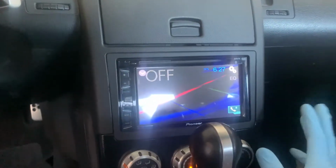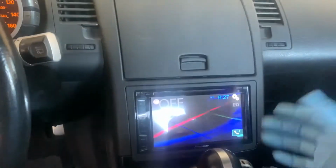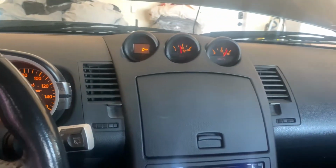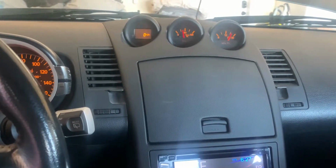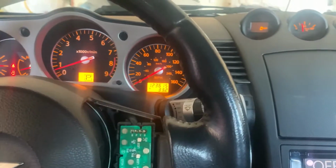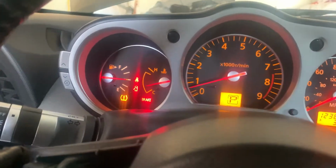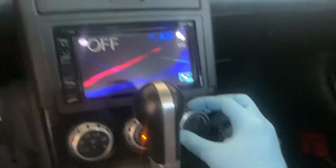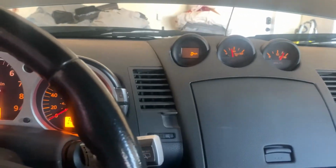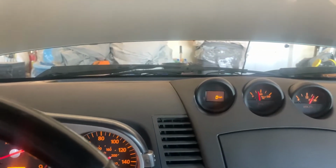This car normally takes about 3 to 5 minutes to warm up all the way, and then I'll blast the heater. What the heater does is it pulls the hot air from your engine and pushes it into the cabin. So you don't really want to be using the heater when the engine is cold, because it'll just keep pushing all the cold air that's in the engine compartment. So we're gonna wait, and then I will pick it up once the car's at operating temperature, the heater's on, and I can go ahead and take a look at the fluid in the cone, because since it's not up to operating temperature, it hasn't opened the thermostat, so it's not bleeding the coolant out of the block yet.